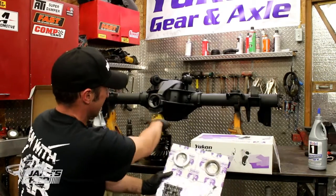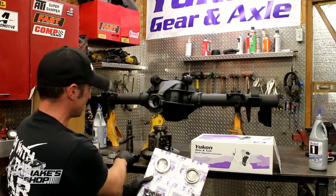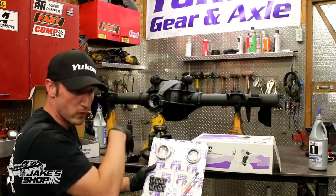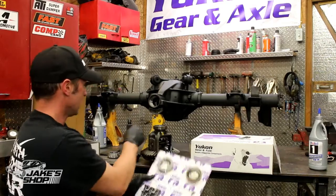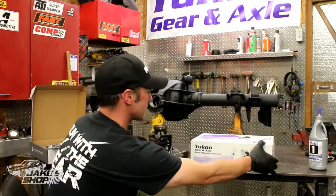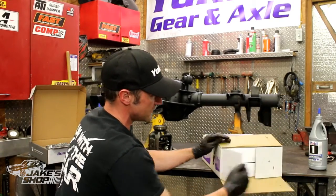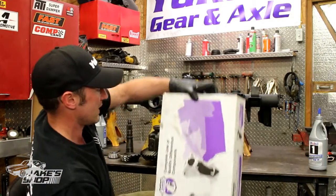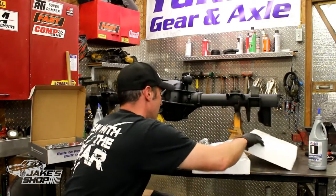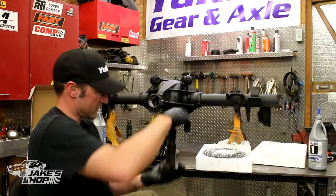In the rebuild master kit from Yukon, I've got the shim packs for the carrier itself and another set of shim packs for the pinion. I'm going to grab shims, mic them, check them, and get as close as possible to the 0.0405 that was the original shim on the initial setup. The new gears are in here — I went with a 3.73. Same thing as with all parts in these kits — if you're using new parts, clean them up. They've got their initial coating on them and it'll actually hinder you from proper setup. Here's my brand new pinion. There's the old one — you can see how much bigger that shaft is on the new one. That's capable of a lot more horsepower.